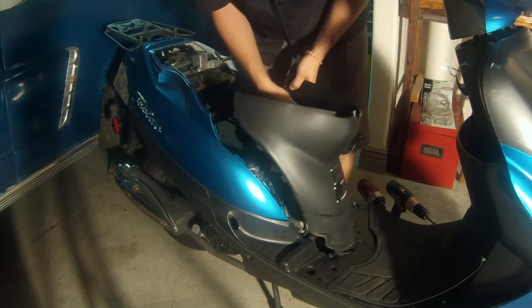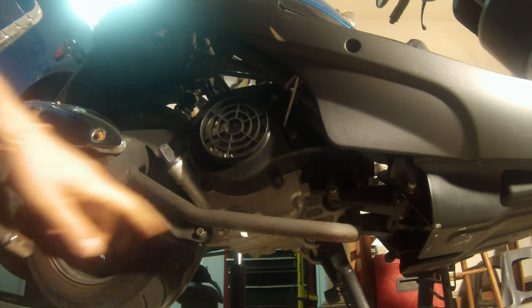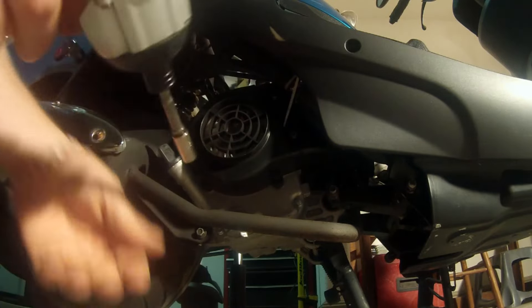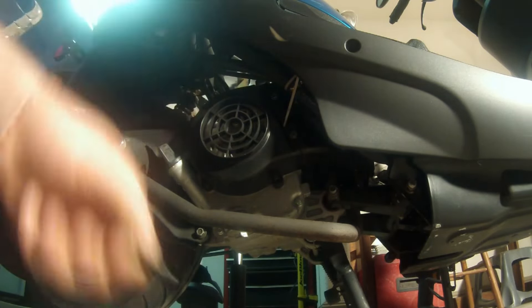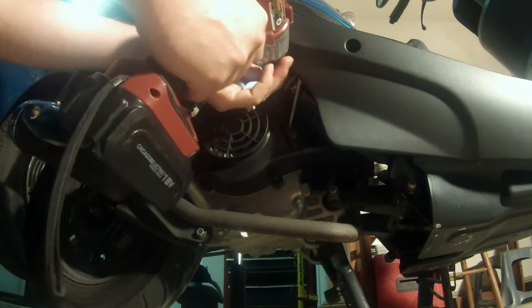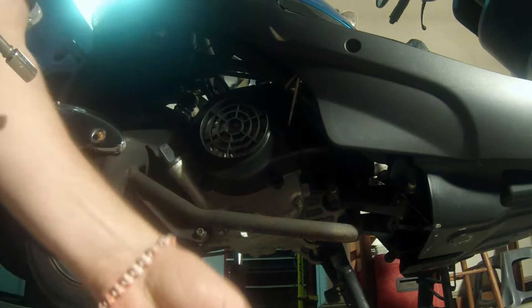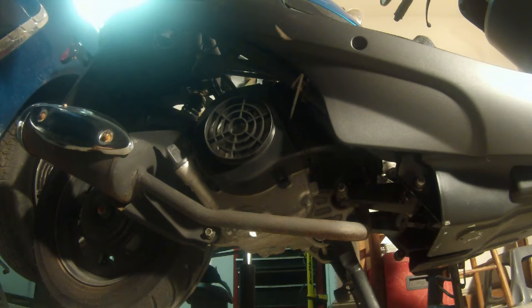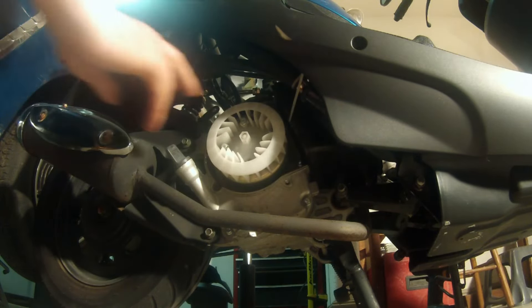Just be gentle with that. The next step is to remove your stator and fan cover. We're going to find multiple bolts — there's going to be one on the bottom here, two nuts right underneath the motor, and then two screws that are hooked to the plastic housing right here. I'm going to set these aside where I know where they're at, and then your housing cover should come right out. Underneath here is your stator and your fan.